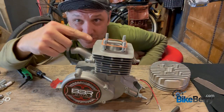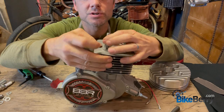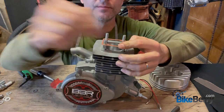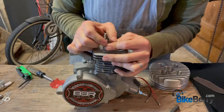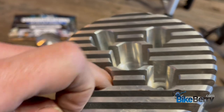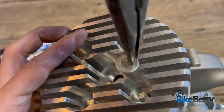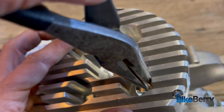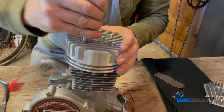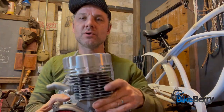Stop right there. As you just saw, I was wrestling with that because these studs are kind of all splayed out. You got to kind of push them in because you don't want to damage this thing — you got to work it. Because of the height of this head, these are hard to get in there, so that's where you got to use the needle nose pliers. Everything's all lined up, it looks good as it should be. The next thing we got to do is tighten it down properly.